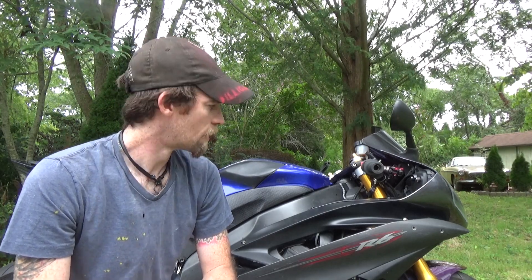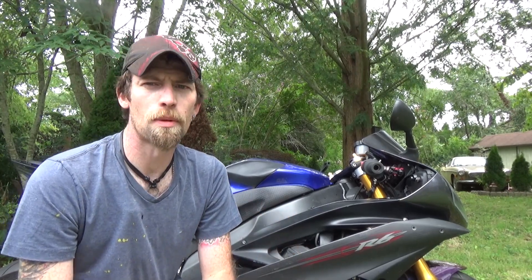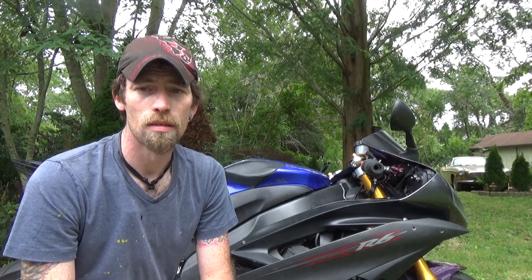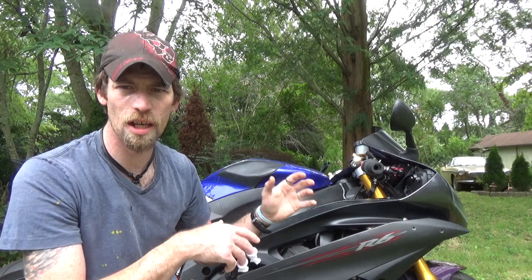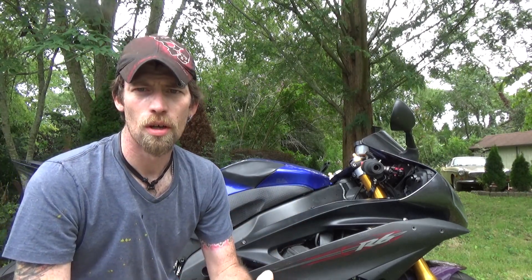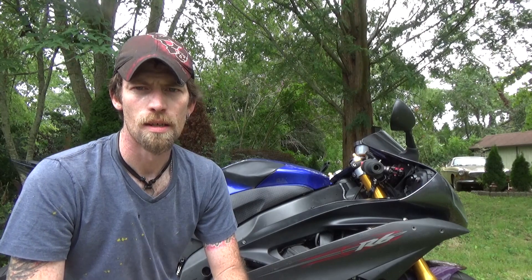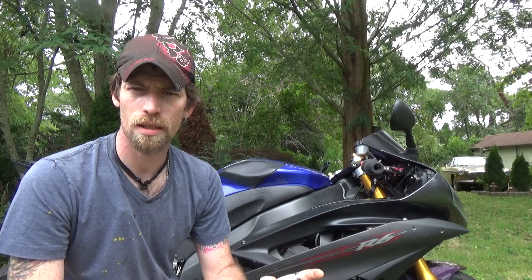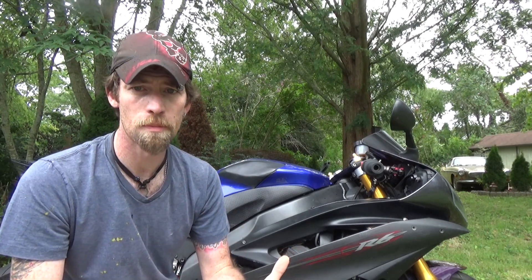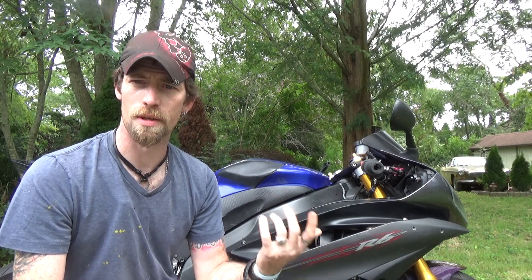I already did that fix and I want to see how soon I can get this bike actually running. There are a couple other things that need to be addressed. It's hard to show because everything's under the tank and under the air box - very cramped, hard to get a camera in there. But on top of the motor are the ports for the air injection system, or AIS. One of them isn't sitting right, so it's basically a giant vacuum leak at this point, and I've got to address that.